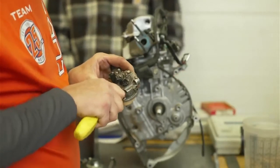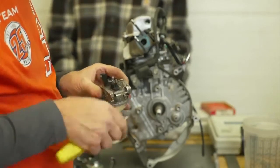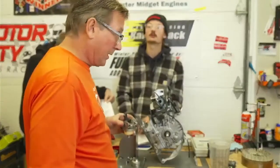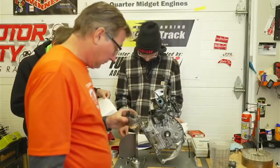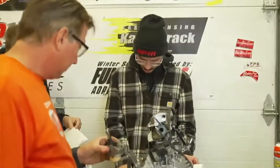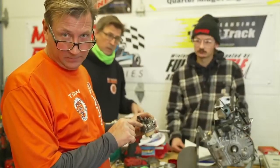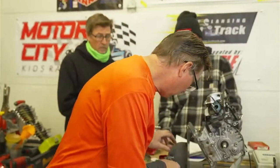When we find a discrepancy, we backtrack to see why. Carburetor number 120 should have 10 holes. We need to find the carburetor number on this carb. The old manual says junior Honda and senior Honda — we need it out of the new manual. The new manual says Honda 120 UT3 carburetor for junior and senior Honda classes, and it says 99L only. This carburetor is a 60B — so that's a DQ. We should have checked that right off the bat. This is the wrong carburetor, so let me go get the right one.